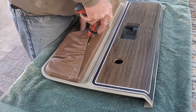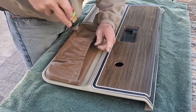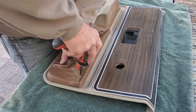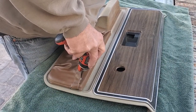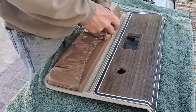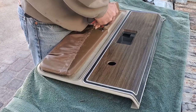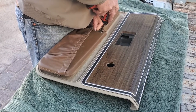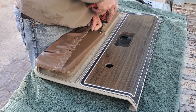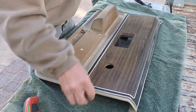Let's get started by first disassembling the things on the door panel. If you have a complete door panel, you're going to be removing this door pocket with two or three screws — one panel had two, one had three. The center one on panels that don't have three is actually one of those Christmas tree style plastic ones you have to pull out.